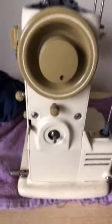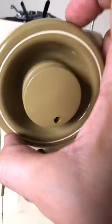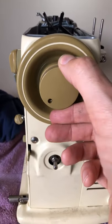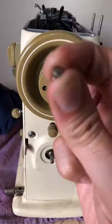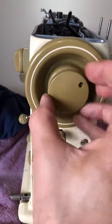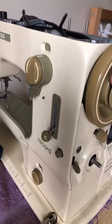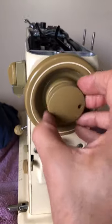Now I wanted to cover something else — it's probably the most important of all. This machine has what appears to be a plastic or resin clutch knob that you use when you're going to wind bobbins — you have to disengage the drive shaft. When I tried this one, it had the little set screw; I tried it and as soon as I turned it, it let go and it didn't fight with me. All these dials and levers have plastic backed up by steel on the other side of the machine, and that steel can get stuck sometimes.